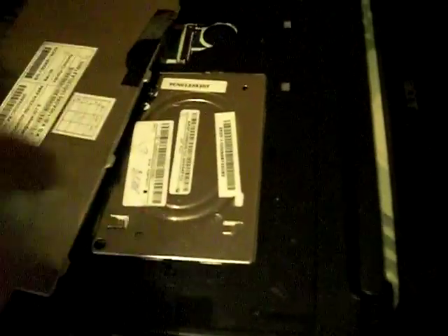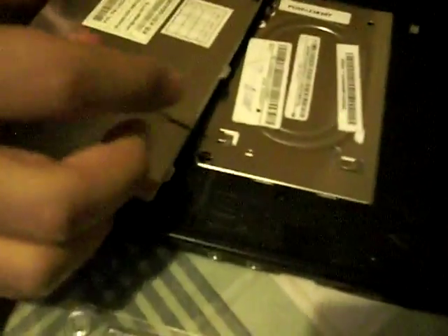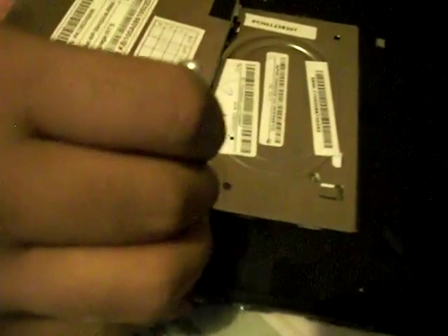You need to take out four screws — the ones marked 'door.' There are only four of them, that's all you need. Unscrew them all, then you'll see a little circle by the hard drive; push down on it, flip your keyboard, put it aside, and close the computer.